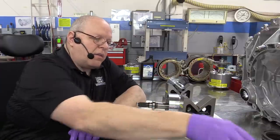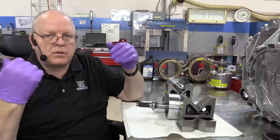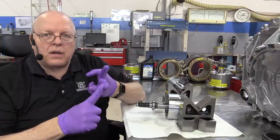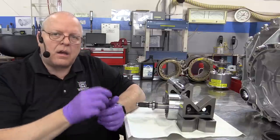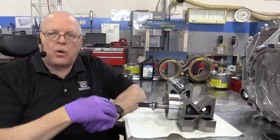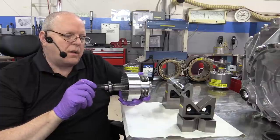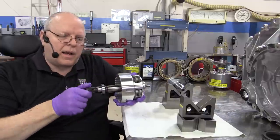There are three pieces of the planetary gear set — whether it's Ford, Chrysler, or Toyota — every one has the planet carrier connected to the engine, the sun gear connected to an electric motor (they might call it a different name, but this is motor A on this Chrysler transaxle), and then the ring gear or internal gear connects to the rest of the transaxle. On the other designs from Ford and Toyota, the input shaft is solidly connected to the planet carrier.